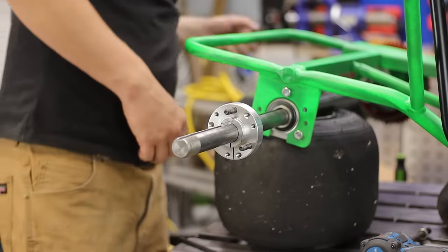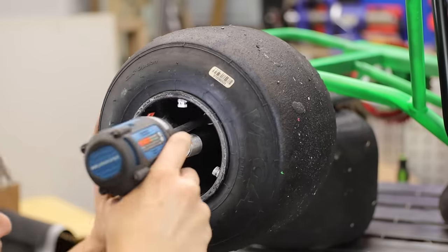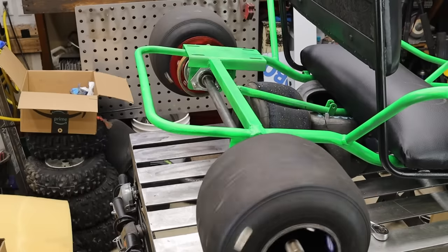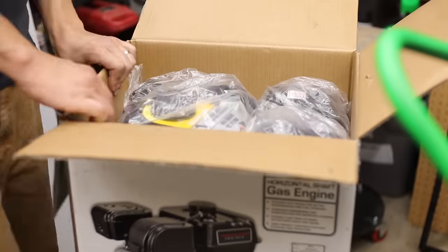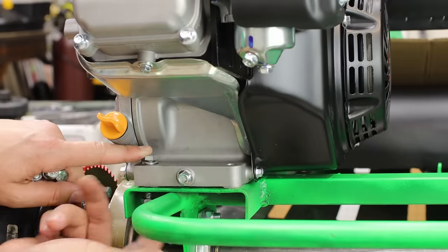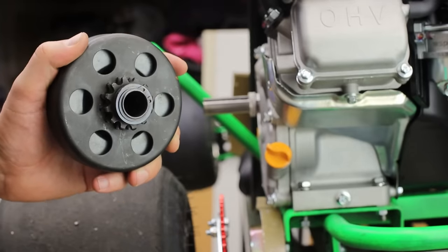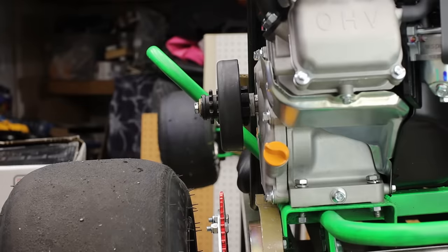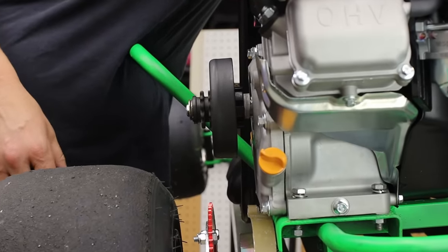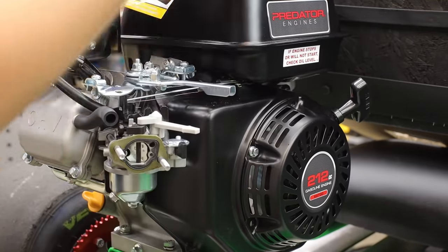These are for the wheel hubs — I got them from a karting supply place. Those wheels had metric diameter bolt patterns, which isn't an issue; you can find hubs for either, just make sure they match your axle. Harbor Freight has sales practically every other weekend, so I went with a brand new Predator 212 engine — it comes in black so it matches all the other accessories. For the centrifugal clutch: use PVC as a spacer if needed. This is a 3/4 inch centrifugal clutch with a number 35 chain — you need to match the bore size of the engine and match the chain size of the clutch with your sprocket.